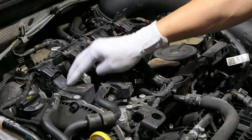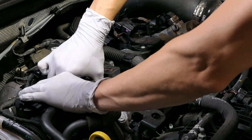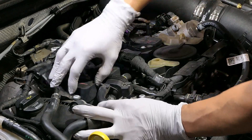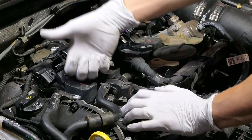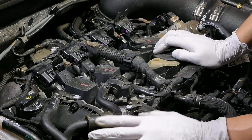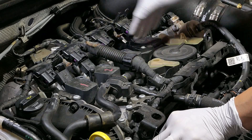Now you're going to remove the coil packs, and as you can see it does not want to come up — I'm physically pulling on it with no luck. What I found online is you can create a zip tie loop on both sides to give yourself a little leverage to pull it up. I'll take care of removing all four, but again you will most likely run into this same issue, so make sure you have an extra coil pack or two in the event that you damage the ones you're pulling out.